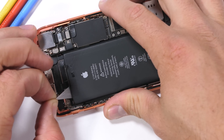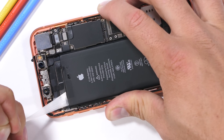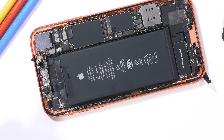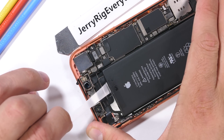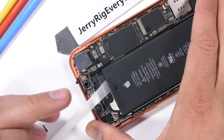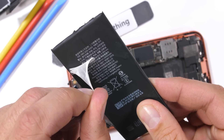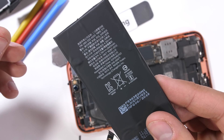If one does happen to break, it's almost easier to grab the remains and start pulling again, because prying the battery out manually is a bit on the dangerous side since punctures are fatal to batteries — we try to avoid that. Finally, the battery is released from inside the phone. This is the 2900 milliamp unit. I'll try linking replacements in the video description as they become available.